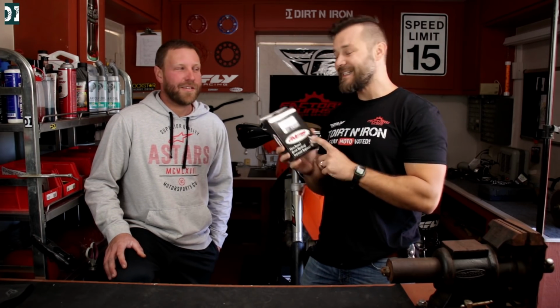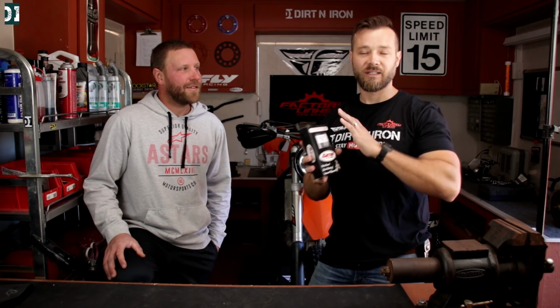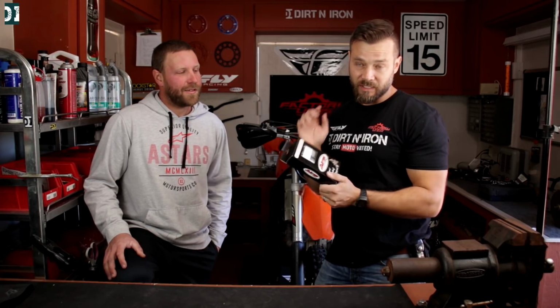And yeah, we could go ahead and play with the jetting and do different jets, do a little bit bigger pilot jet, and then put your needle up and down, and maybe we can dial it in. Or what I usually do, go ahead and get a JD jetting kit. These guys have it dialed in. They put the same bike on the dyno and test all the settings, different elevation, stuff like that. And I had a very good experience with this kit.